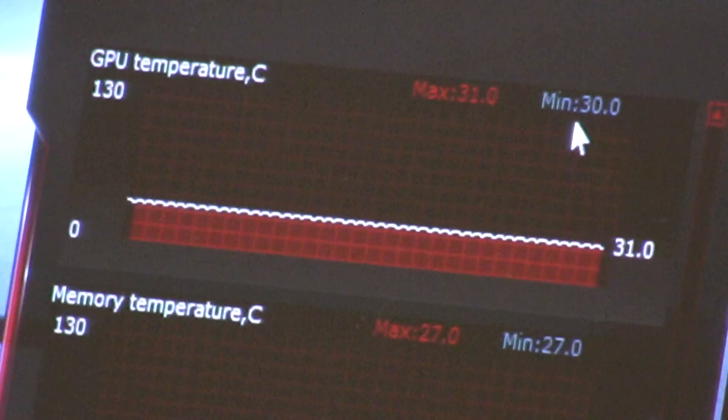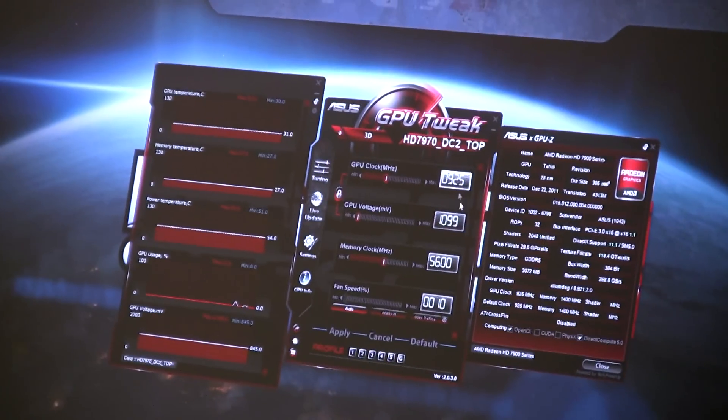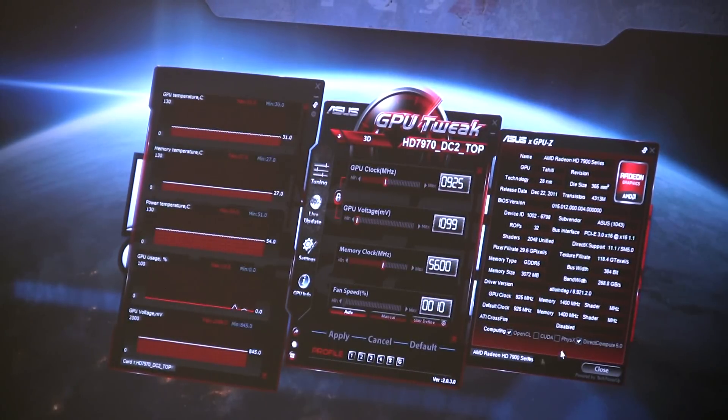The card is running very cool and very quiet. We're solid and good to go, running the card at stock parameters, as confirmed here by the integrated GPU-Z module. One of the great things about GPU Tweak is its easy ability to overclock the card. Before we jump into Mass Effect 3, we want to bump up the clocks a bit, so we're going to unlock it and switch into advanced mode. From there we'll clock up the card — jumping up to 1100 MHz for the core clock. And for the GPU voltage, we're going to bump that up a bit as well, setting it to 1150.